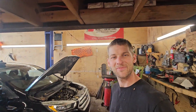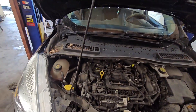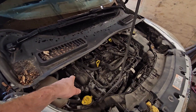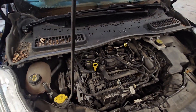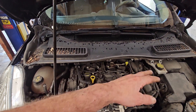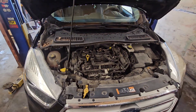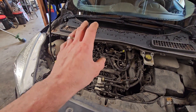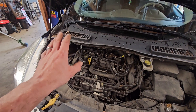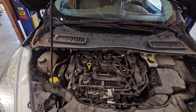It's a new day. Heard from the customer — they want to go for the whole shot on this. So we're going to do camshaft, fuel pump, the little follower, and since this is a timing belt engine, we're likely going to do a timing belt when we get that apart. We'll check the water pump and see what that looks like — maybe just do it. Also, the customer requested a tune-up, so we're going to get some plugs. But first things first, let's peel this onion, get her all ripped down, and make sure there are no mystery parts I forgot. I got everything ordered from the dealer and I've got about a week waiting on the camshaft.